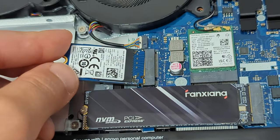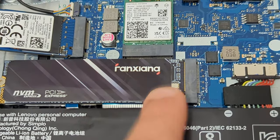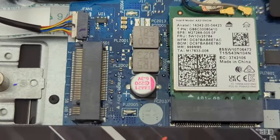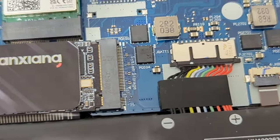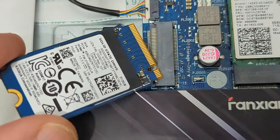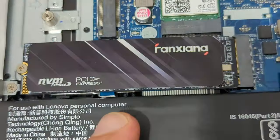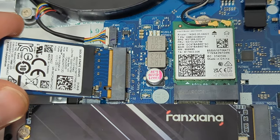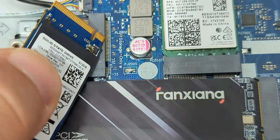I installed this one — I didn't do a fresh install. I had the Windows 11 boot stick in there. The second M.2 slot is labeled as 'storage only,' which supposedly implies that if you put a Windows drive in there, Windows won't start from it. This is total utter bullshit. It doesn't matter if there is an empty drive in the other slot — when this Windows drive is in here, you will still boot from it. This information is also lying to you.